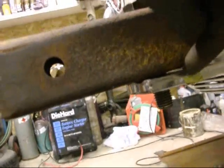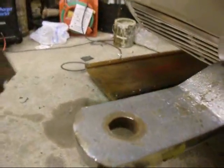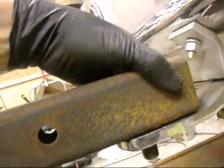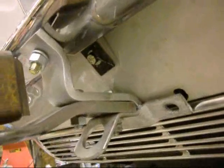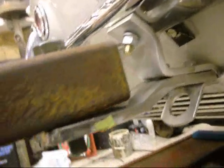I was thinking of drilling a little hole and welding on a little nub so it can't turn. I don't want to bugger up this nice original trailer hitch - this is a Valley trailer hitch - so I don't want to put a bolt through there, it isn't necessary. Just drill a little hole there and weld a little nub onto that and it'll stop it from turning when I squish it down. I haven't figured out what to do here - I don't want to drill those holes bigger. Gotta cut that strap and move it a little bit.